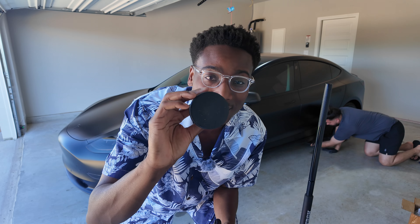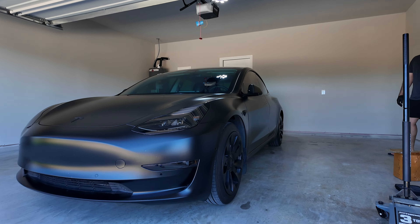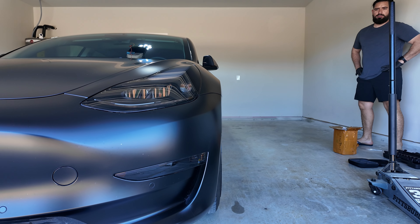He's a good man, y'all. If you have a Tesla, whenever you're jacking your car up you need these pucks. The pucks help distribute the pressure so you don't puncture your battery. I just want to show y'all it before so you can see these are the stock tires.